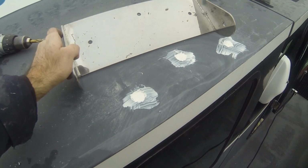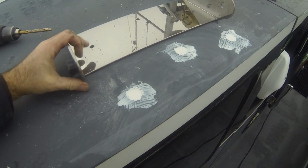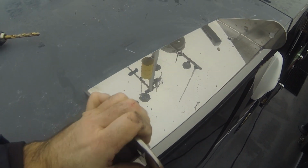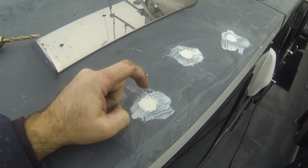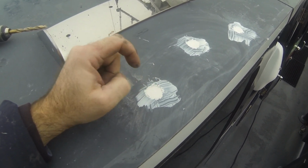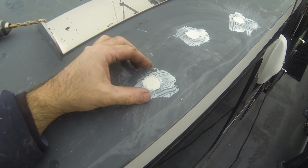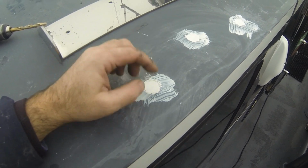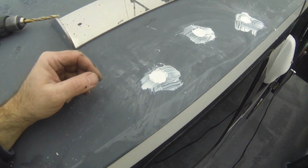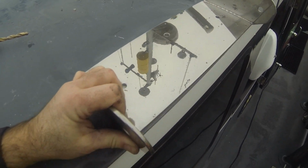So I've got to put this stainless bracket on here, and they're 10mm bolts. So I've offered it up and drilled the three 10mm. Haven't gone all the way through, I've just gone through the top skin and stopped at the bottom skin. I then got a 25mm bit, opened it up, taken the core out, and then I've then filled that with a filler. So the plan now is to put that back in there, like so.